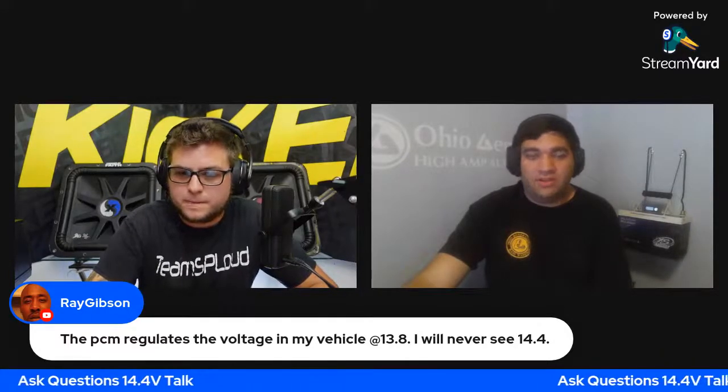I see this Ray Gibson comment here: PCM regulates the voltage. What type of vehicle is it? Because it may not be PCM controlled. Yeah, it sounds like a Honda. I know Hondas are notorious for that, or GMs sometimes too, with their Chevys. At 13.8, that seems like a Chrysler vehicle. Yeah, that doesn't sound too off. Do you have a Chrysler product? Because that's not PCM.